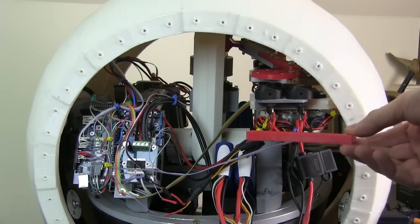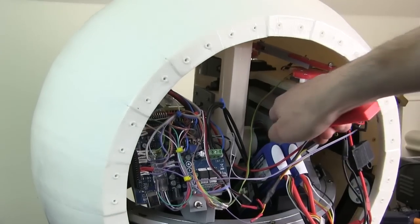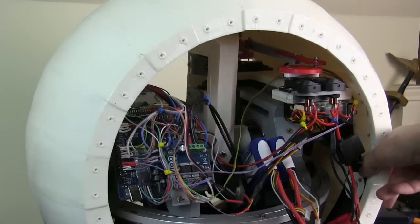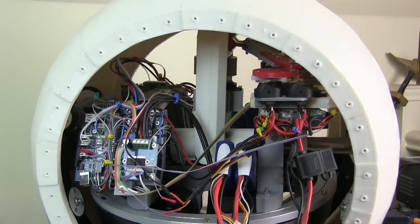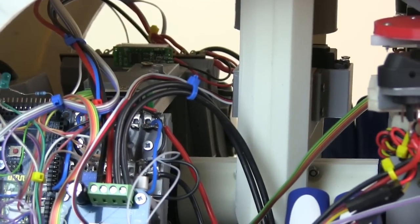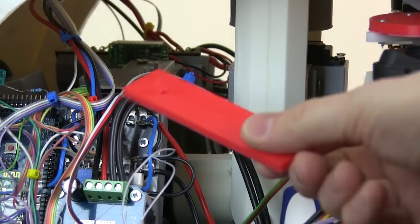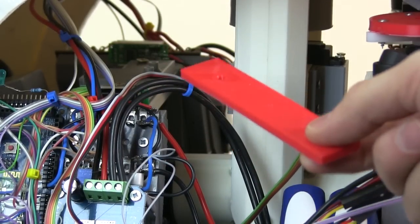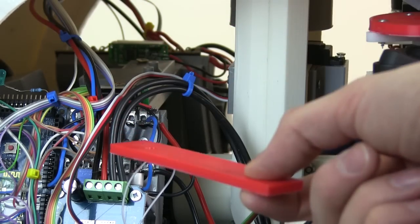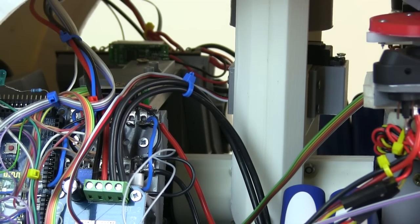I've made some shims which are 10mm and also one that's 5mm. Those are going to fit in that gap there, which is currently 15mm, so it can drop down — I've got two 10mm shims for that. I also need one to go underneath the pot mount, where I put a pot that measures the side-to-side motion, which is mounted on that bracket, so that's going to need to stay where it is. I've got a smaller 5mm shim to go under that, so instead of being 15mm higher, everything's 10mm higher, but we'll get those fitted and see how much better it drives.